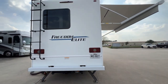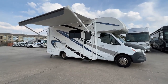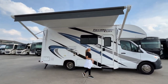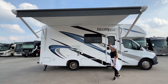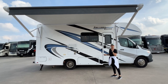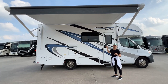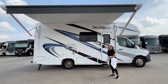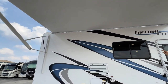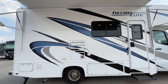So we're going to look at the front. As you can see, there's a really large awning that pretty much covers the whole passenger side of the RV, and there's a switch on the inside for that. We recommend that if you're not with the RV or if there's any sort of wind at night, you bring it in — these things do not have a wind sensor, so they will come off. So we want to make sure that we keep it in and keep an eye on the awning. You've got a light strip here, and there is a switch inside as well.